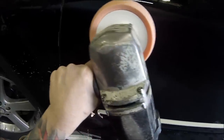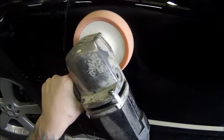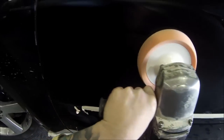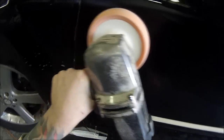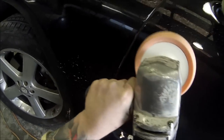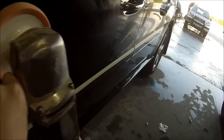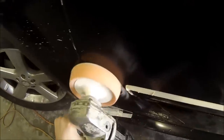This is 2000 grit — if you went with 1500 grit it'd take even longer to polish up. You've got to be careful with some of the polishers and cutters; get the car outside in the sun, because it may look polished up inside the workshop but you can then take it outside and find you've got a few sanding scratches left behind. So it's important that you go over each part a couple of times, and if you follow this method you should get the same results.